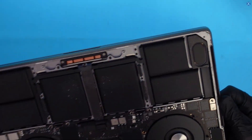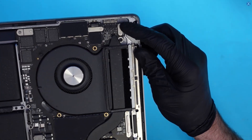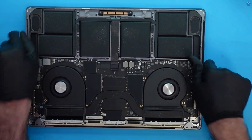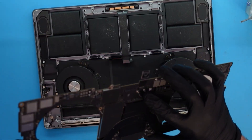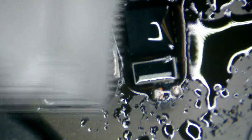So let's open up and take a look. See if we notice anything. It looks pretty clean there. I do see a stain over here, and I believe that's for the power button — it looks pretty good for the most part. So we've removed it and we've got the board out — over there to the microscope to take a look further. We're just going to do a visual inspection of the rest of the board. We have some corrosion over there, so we've got a liquid spill. We'll remember that. It doesn't look too bad — clean it up a little bit. Very minor. We don't even know if it necessarily needs anything.